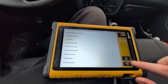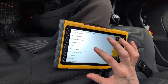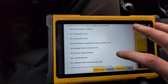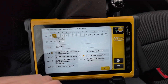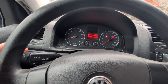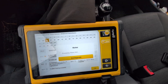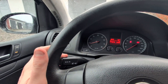Now let's go to central electrics and check if there is something there — module 9, central electrics. Let's check adaptation first. I noticed I had turned off my comfort turn signal without even noticing. So if you do this tap, it should blink three times. Coding success. Nice.